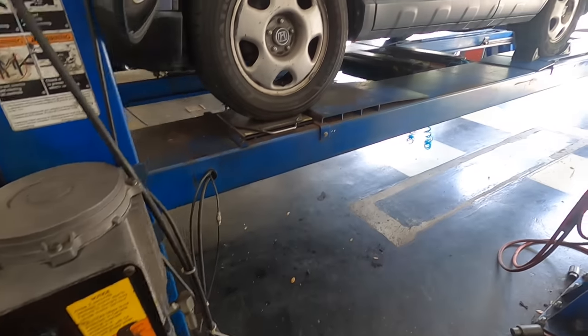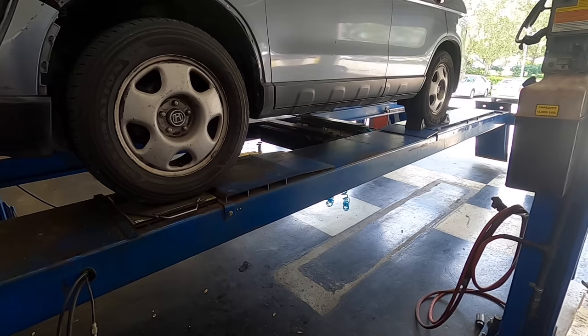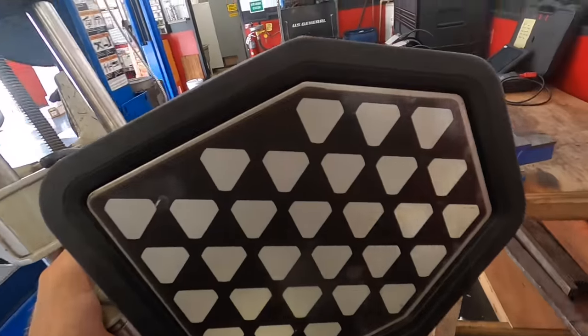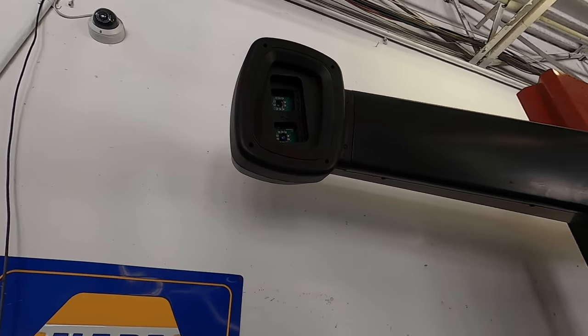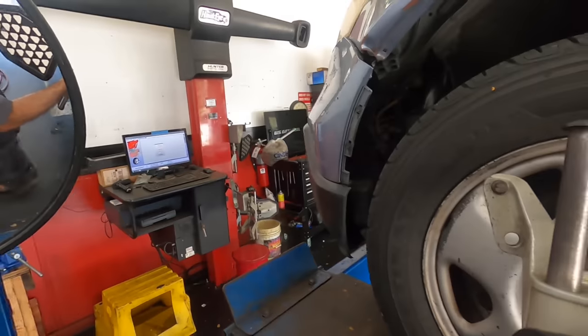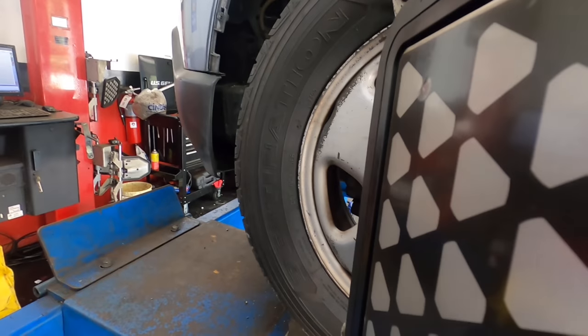Okay, and down. Both ramps should be flat and level on both sides now. Let's install the reflective heads. The way this works is there are a series of lasers and cameras up top — it shines the beam at these reflectors, the beam reflects back to the cameras, and that is how it measures the direction that the wheels are pointing.